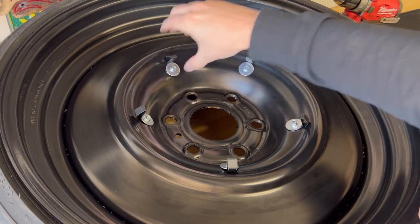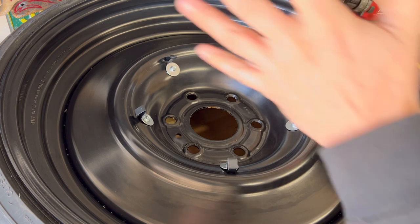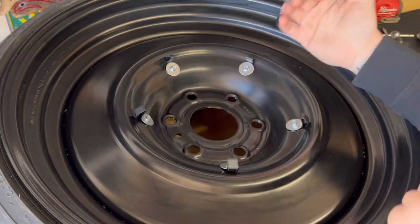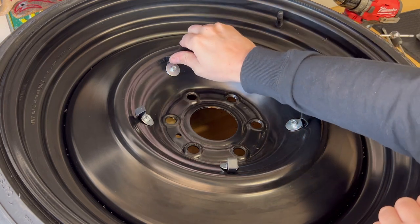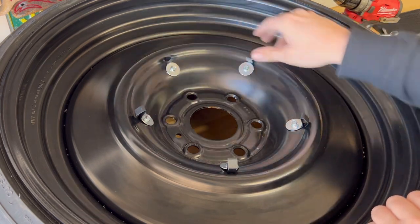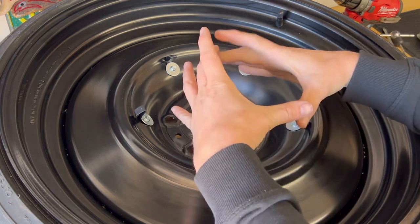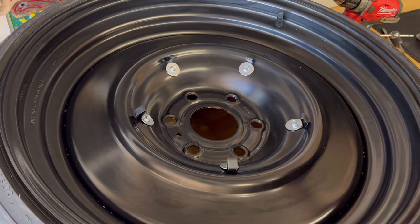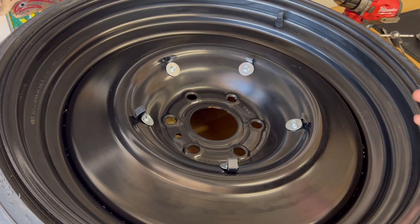And go through and make all of them wider just a little bit, and then see if it clips on there and it's tight. If it's not tight, the second step that I had mentioned, then you're going to push out on all the clips. That will make the radius a little bit larger. That way it can get on there. That's just in case maybe you're watching this and you've got some old cap clips that have those issues. That's how you would fix them.